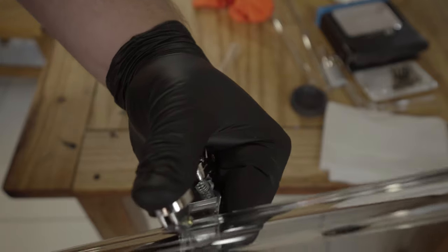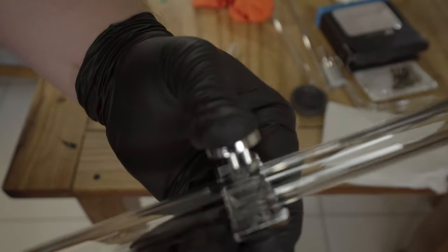glass. I definitely used less pressure initially rather than pushing down with my entire hand. I just used my thumb and forefinger to create that first guide cut, and then increasingly ramped up the pressure. I found this prevented the wheel from skipping around.